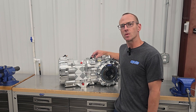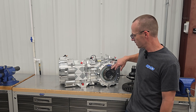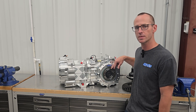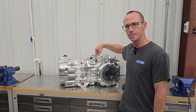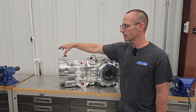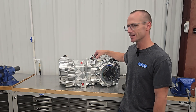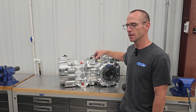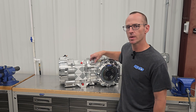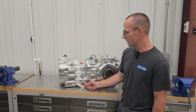Let's take a look at some of the features in more detail. This particular one we have right here has 934 flanges on it. It will be available with 934 or also 930. Up here we have a speed sensor that's actually looking at the pinion gear, so if you change your rear gear ratio or your ratios inside the gearbox, this is downstream of that — so you're actually seeing the speed of your axles by looking at your pinion, same as we do in our standard gearboxes.